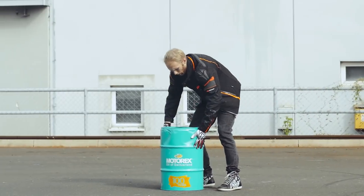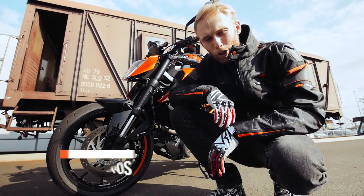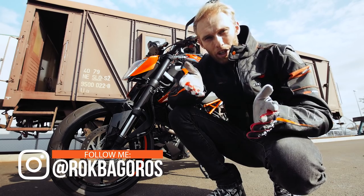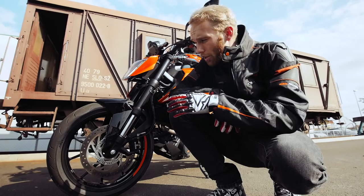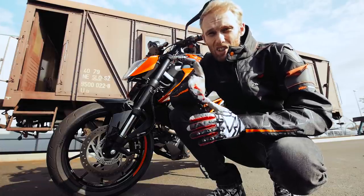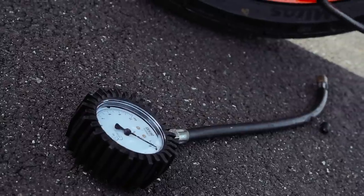The acceleration area is important because you can review your progress. Before we get to the action part of the tutorial, we need to check the front tire, which is actually the most important part when doing stoppies. First, check if the tire has enough tread profile on it and if it's not too old — an old tire doesn't have the grip you need while doing stoppies.